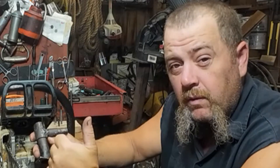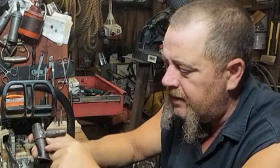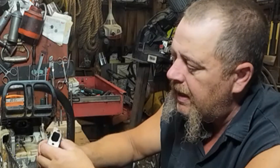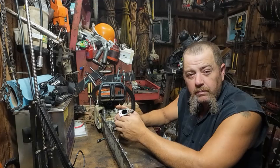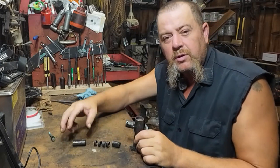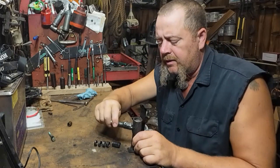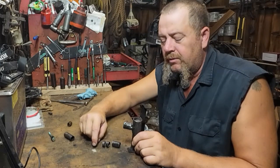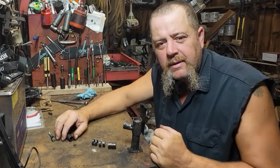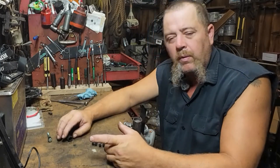We adjust this in and out on the dyno. It was neat to pull that apart and see just how much I was pulling out. Theoretically, maybe without a dyno, a guy could read his pipe and decide he wants a little bit longer or shorter stinger. So what we did — we took a long pipe, just about as long as you could use on the saw, put it in here, and just started cutting it off about 300 thousandths — about a quarter inch, a little over, a little less. It wasn't exactly technical — just held it with vice grips and cut it off with a cutoff wheel, but we took a measurement each time.